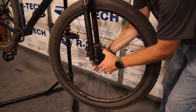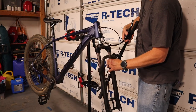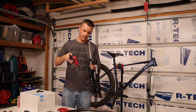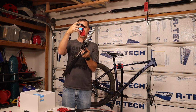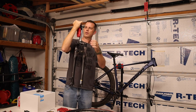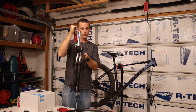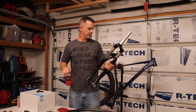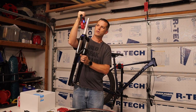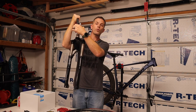Let's get into the bike. We'll start by removing the front wheel with the quick release, then grab an Allen wrench to remove the stem, and then finally the fork from the headset. I kept hearing these stock forks were heavy — they are no joke. I'm going to get a scale on these things. These are coming in at 6.36 pounds. Now let's compare them to the RockShox. The RockShox already feel lighter and they're a much more substantial fork.